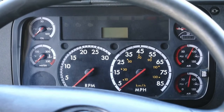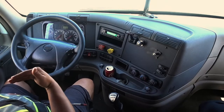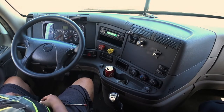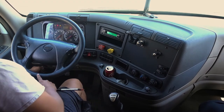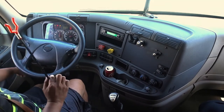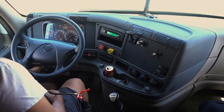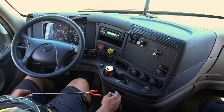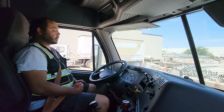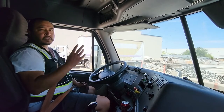Find your brake — now it's at 90. You'll tell them: I'm gonna go ahead and charge my vehicle. Clutch in, turn your key on, and let your needle settle. Once they're settled, go ahead and turn on your vehicle. What you want to do is charge up your truck. Once you hear your governor cut out, that means your truck's fully charged.